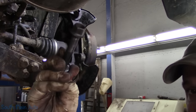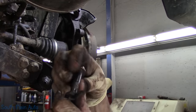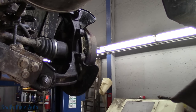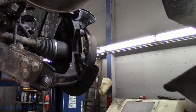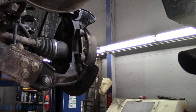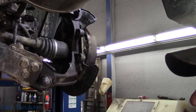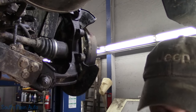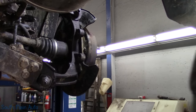I also cleaned up the bolt that goes in the front on the old wheel. We will get that one never seized in the same manner. It's amazing how easy they slide in. I say that before I even slip this one in. And to know that just a couple thousandths of clearance of rust can give you a headache, a big one in some cases.